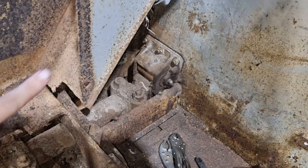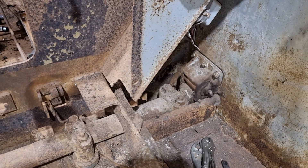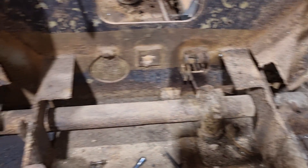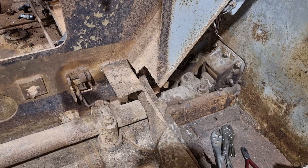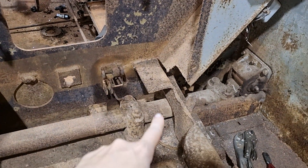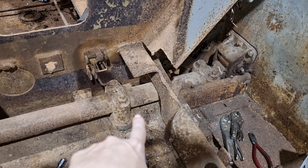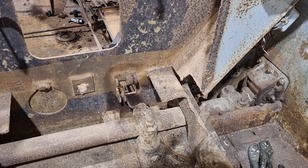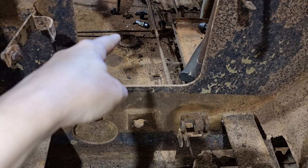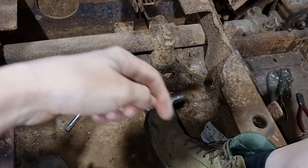You can see the rollers that allow it to move back and forward. It's a really quite honestly very rudimentary setup — there's no real fancy engineering going on here. This is all just lubrication and rollers, nothing fancy, and it's all controlled by the steering wheel. Which means the steering gets quite heavy — this is the reason why I can't turn the steering wheel, it's because it's connected to here, and that plate is just rusted on at the moment. So this entire assembly can't move left and right, which is problematic. Before I move from here, I'll just mention that plate there is where the gear selector goes, and it comes through that little hole there — I moved it yesterday and it moves to the gearbox which would be behind me, but there's nothing there at the moment.